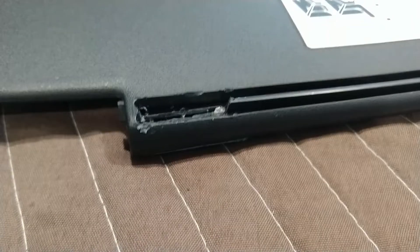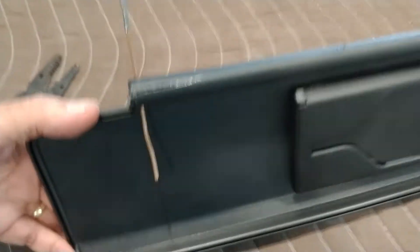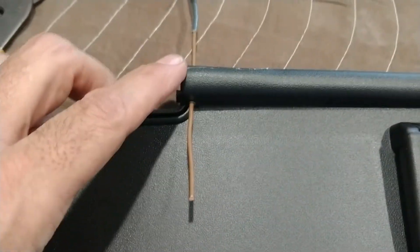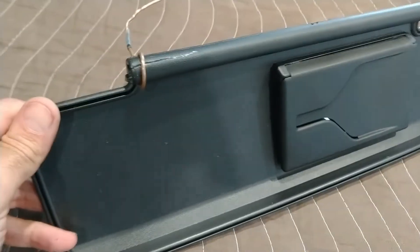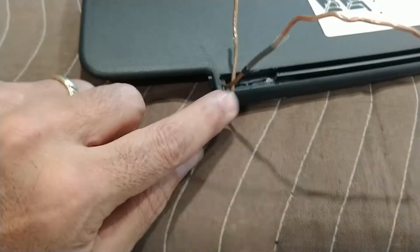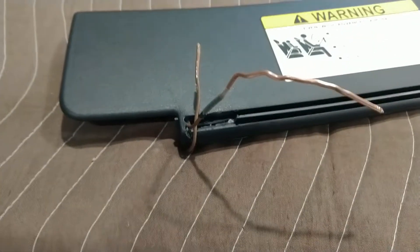Now you can insert that wire and start wrapping it around, prepared to lock it in. Here's my insertion of the wire. Flip it over and you can see it comes out this end. I come in with needle nose and channel locks — when you wrap this around, you want to make sure it's tight. Wrap it all the way around to this portion here so you can get ready to twist it to lay it in. There's the wire wrapped around now, loose of course — I haven't twisted it tight. The other thing I do is put a little notch right here with side cuts or whatever. It helps when you start twisting — the wire will lay in there and help keep the little wire from sliding either up or back on the visor itself.